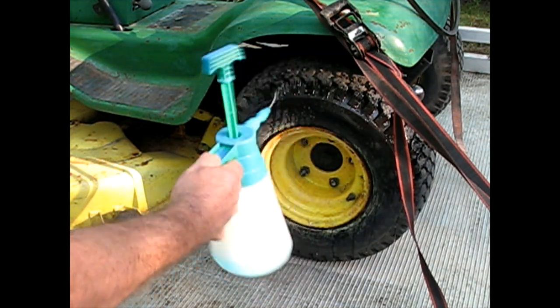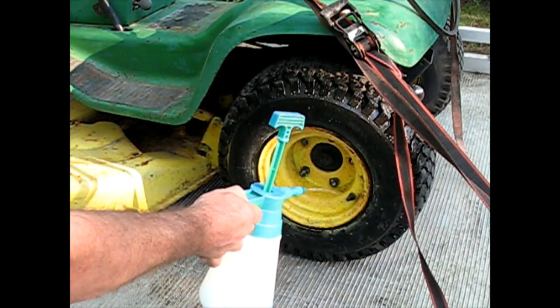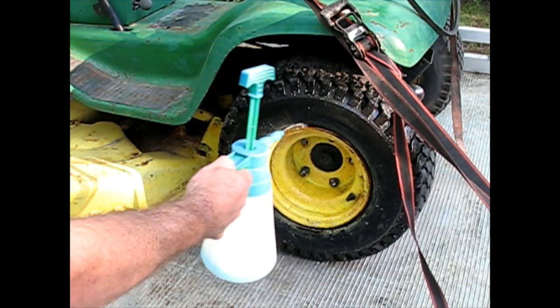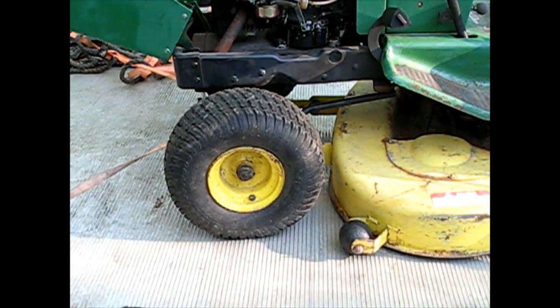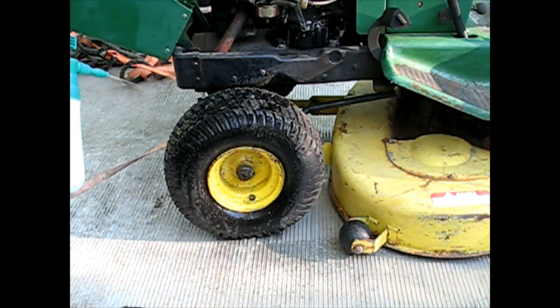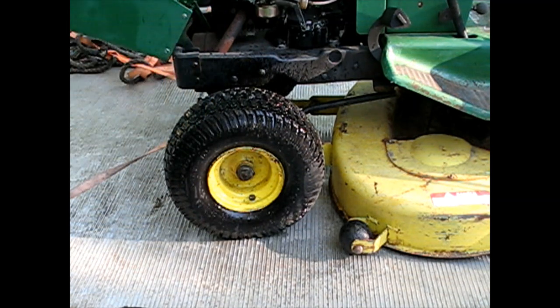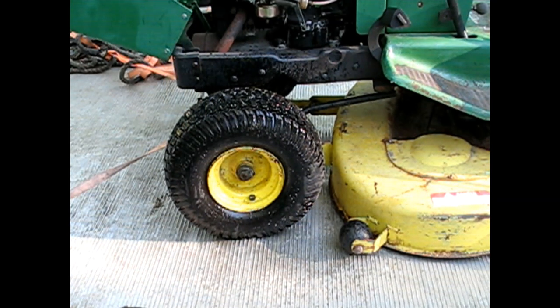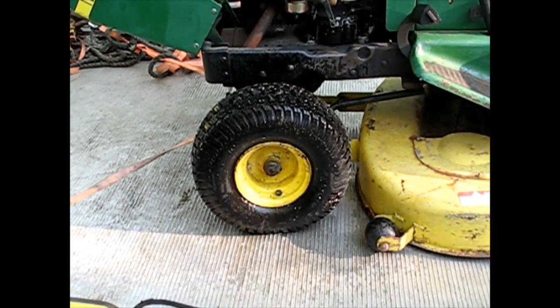And if I didn't already mention, I just aired up all these tires. So we have, you know, good air pushing. Check that valve stem. Nothing I see there right off the bat. And then this one wasn't down when I got it, so it's probably good, but let's just check the valve stem and everything. I have no reason to believe that one should have any leaks, because it was up on air when I got it. The lowest one was the back left, and the front right was all the way down when I got it. So let's go look at our bubbles again.